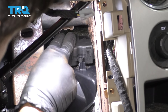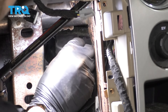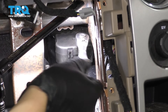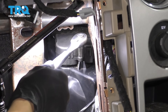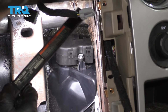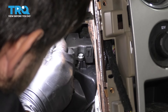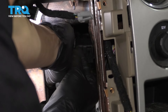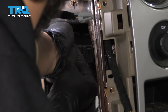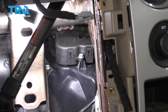Now we just have to put in the two mounting screws. I'm going to put in the front one first because it's easier to reach, and doing this will ensure that this stays in place. Snug it — not more than an eighth of a turn after it's bottomed out, because you don't want it to strip out. Now comes the more difficult part, which is putting in the bolt in the rear. It's basically impossible to show because I can't even see, but it's almost bottomed out. That should be tight enough — snugged up, and that's all we need.